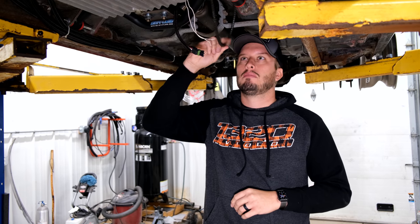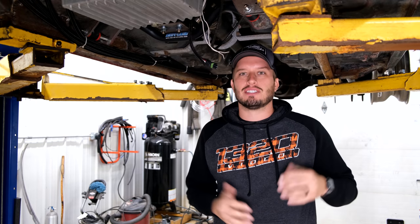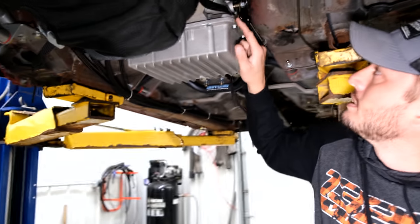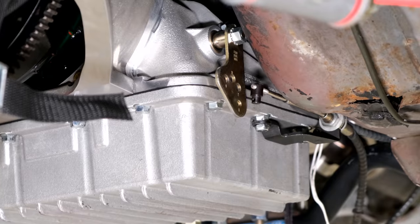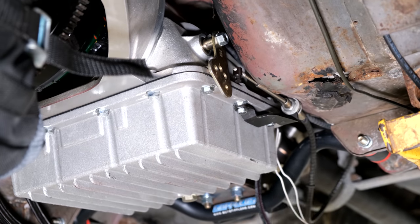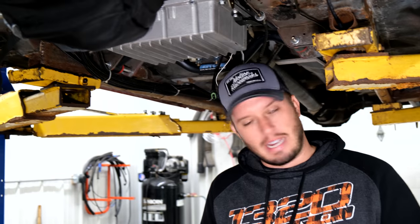We're setting this one kind of loose and then we're going to reroute it and check it again, just to make sure — we don't trust it until it's done. The first thing you want to do is: any transmission — Powerglide, 400 — will come with these linkages, and the linkages have all kinds of different holes on them. So you want to make sure you're in the right hole for the right shifter. Even on the same brand, say you have a Powerglide with five different shifters they carry, they might use different holes.